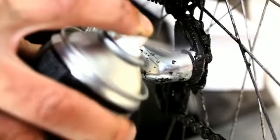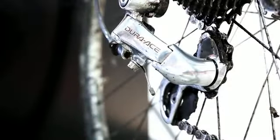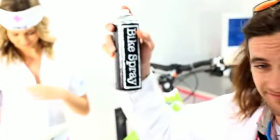The chain cleaner is quick drying and no need for water, but a final spray off, a quick dust off with a dry cloth, and it's ready for lubing. For this patient, we're only cleaning the drive chain, so apply bike spray to drive away moisture before lubing.